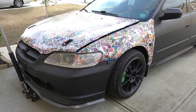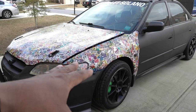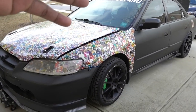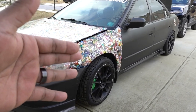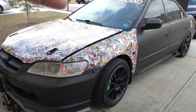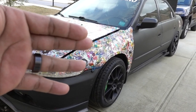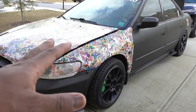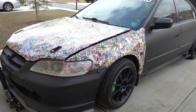Okay guys, so brakes are done. Now I just have to go for a little drive. I gotta bed the new brakes. Going from 60 to 0 a few times, so we transfer some brake pad into the rotors. Like that, we're not gonna have any noise. The brake pads are gonna last a lot longer and it's gonna brake really good. So I gotta do the bedding process right now, and that's all it is for this episode.